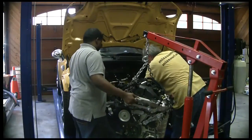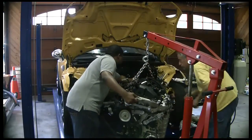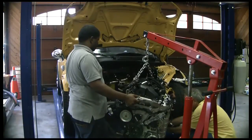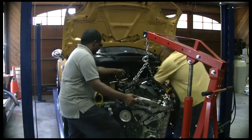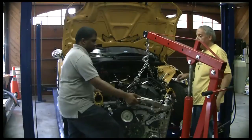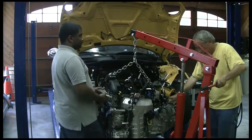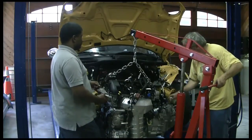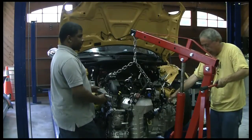And look at that — we've been looking at this all day. We've got the slave cylinder for the clutch. We're going to go ahead and release that and then show you the rest of the engine coming out. We did find that there was a line from the slave cylinder — we got 99% of it, so don't forget there is a slave cylinder. It obviously is on the engine and transmission removal as a unit, but I missed it.